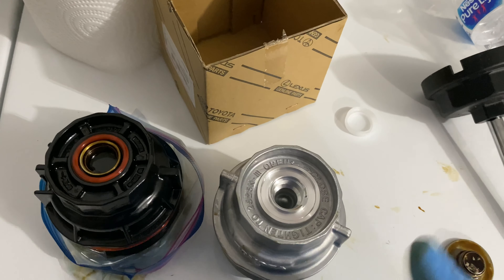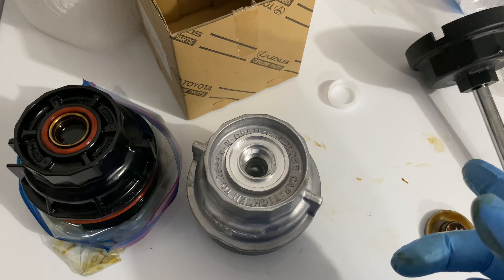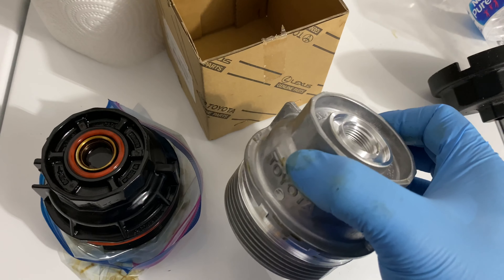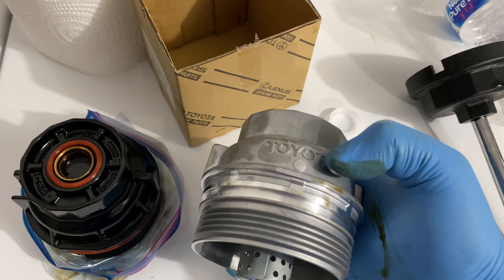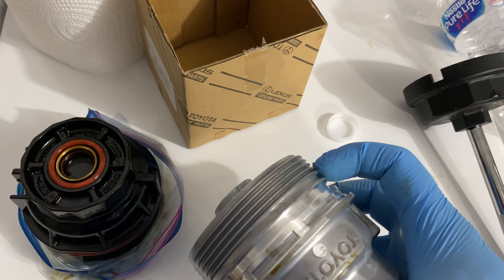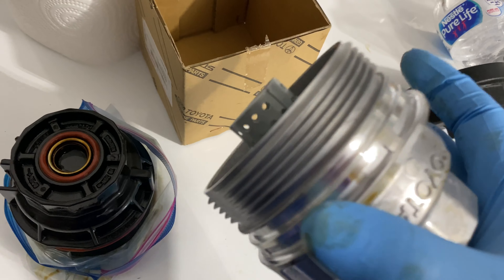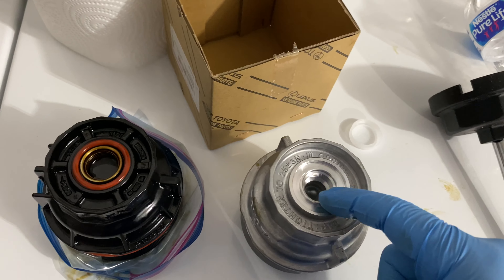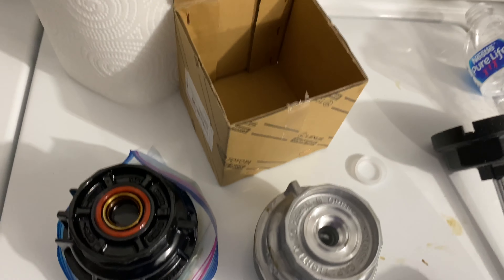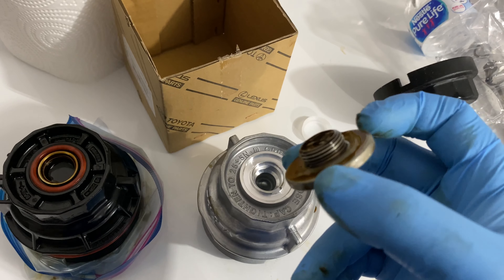Here's the replacement — just do it the same exact way. I have another video on doing an oil change for the RAV4 — reference that video on how to remove and replace this. You're just transferring the seals over to the new one and that's all you've got to do. Genuine Toyota — it's just metal — this is going to handle a little bit higher pressure. Put some oil on the threads so they don't seize once it's on the engine. Also put some oil around the O-rings before putting them on to keep them lubricated, and clean up before putting the drain plug back on.